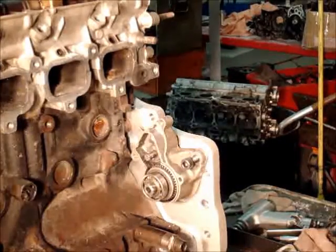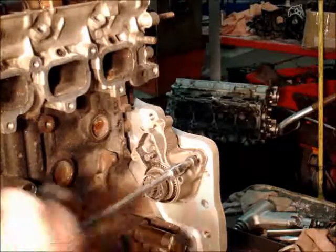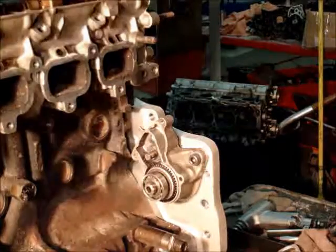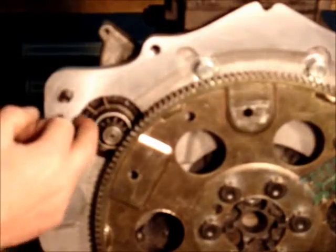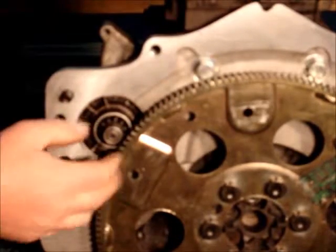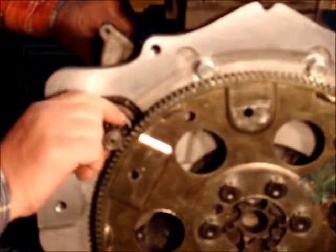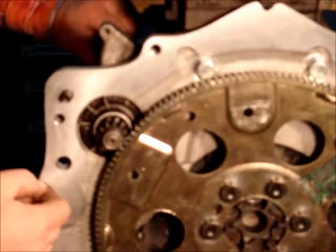This starter clears the stock manifolds, the intake manifolds, and any other kind of intake manifold you might have. That's just the gear body. The reason I did that is I'll show you how I lined everything up. This major hole here is what really locates the starter in here. And you've got the standard 153-tooth flywheel, and I got the Jegs little gear in here. And I can reach in and imitate how that starter fits up in there, and then I can rock it. I put about 30 thousandths in there so that I got a nice fit. It retracts real nice. Everything works real well.